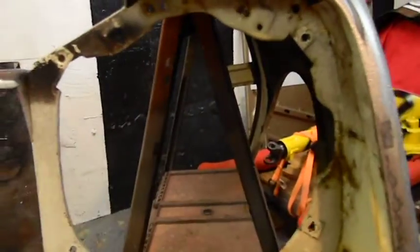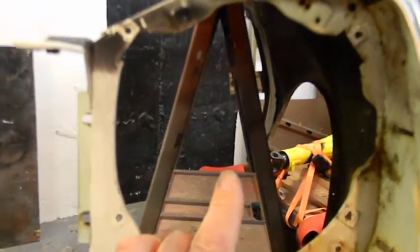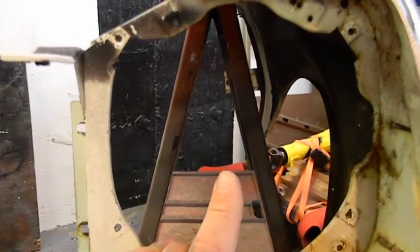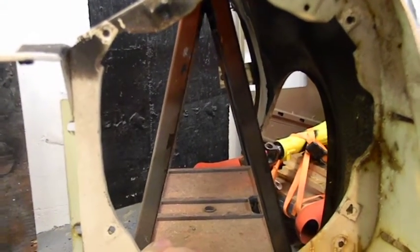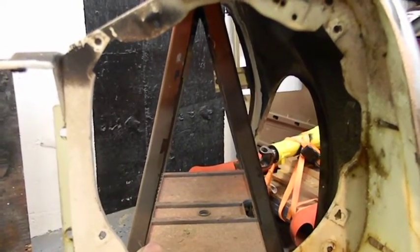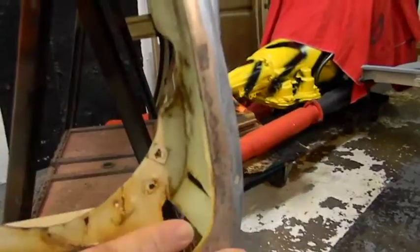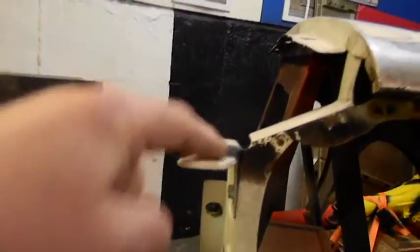This hole houses a rectangle headlight in 78. You can see how thin the metal is right there from it being worked. In 78 it housed a square headlight in a Concord. In 77 and 78 it housed a round headlight in a Gremlin. And in 78 on the AMX only, it housed a round headlight. There was no outer trim. And this also holds my grill. So I knew that buying it, but it is like a no-brainer.